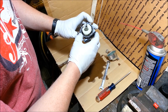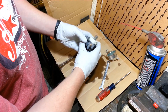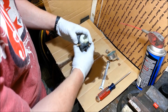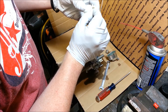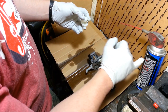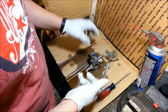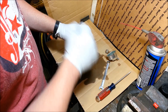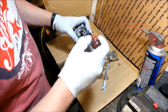That actually looks really clean — I'm sure I just have a minor blockage. This is your float. You're going to remove that — there's just a little pin that slides out. Slide out your pin and it'll pull out the needle with it, which has a little rubber tip. I really don't like spraying that with carburetor cleaner because it's acetone. Carburetor cleaner is pretty much just acetone and it'll dissolve some plastics. These plastics are really resilient and fuel resistant, but sometimes the acetone doesn't like the rubber.